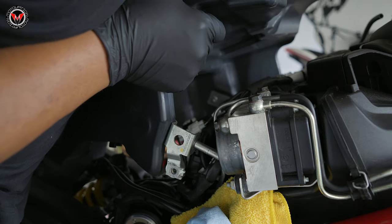Quick tip: if you're going to install this yourself and your bike has anti-lock brakes, make sure you turn the bike on when you're bleeding the brakes or running the DOT4 oil into the master cylinder. You want it to go through the entire system and back down to the caliper — make sure the bike is on while doing that, otherwise it is not going to do anything. That was one of the challenges I faced, and having the guys at MotivationUSA.com helped guide me through it. This is not part of the manual that comes with the master cylinders, but it's something to be aware of.